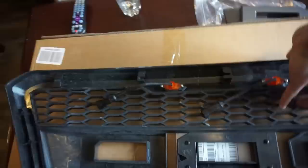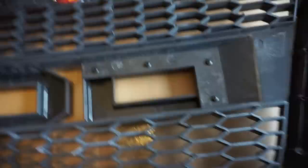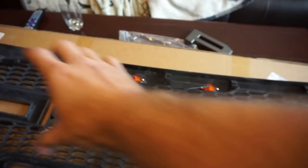All you're going to do is flip it over, and you can see you've got four Phillips head screws to remove right there. Then you'll just slide these guys underneath on the other side and screw the four screws into the four holes, and when you flip the grill back over, it'll say Ford. So what I'm going to do right now is take my Phillips head screwdriver, unscrew those eight total screws, replace them with the F and the R, screw the eight screws back in, and then I'll show you guys what it looks like once the grill actually says Ford.